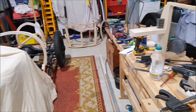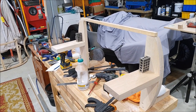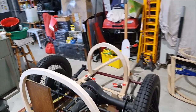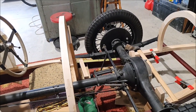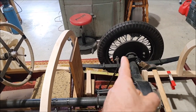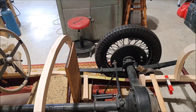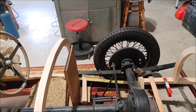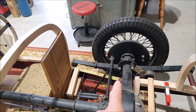I have started doing the timber around the axle openings. Thanks to a friend of mine who sent me the actual dimensions they need to be — I had to guess mine based on pictures of original cars. It's a very difficult thing to measure because the brake drums on this car are pretty big and there's a backing plate, so you can't see the opening in a side-on shot because it's hidden behind the wheels and brakes. I ended up being about an inch off in the width, so my opening is a little bit wider than on an original, which is nine inches.